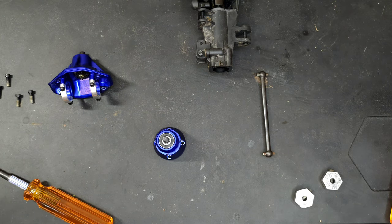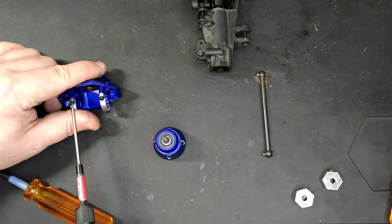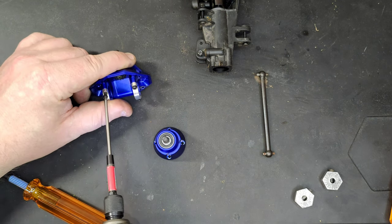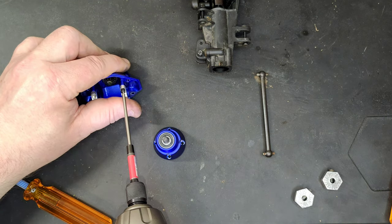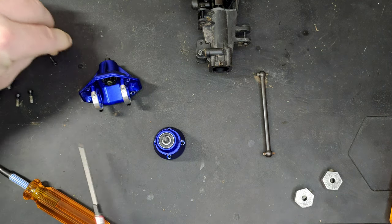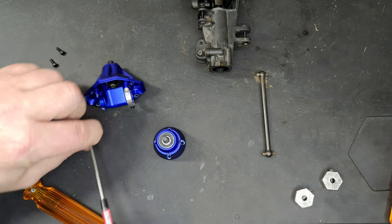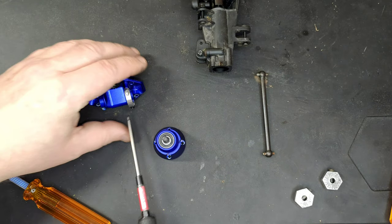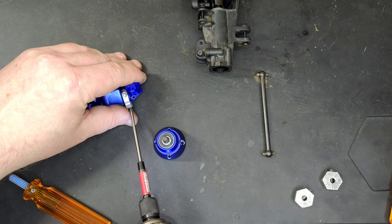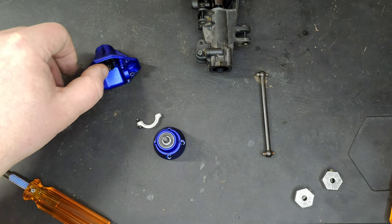Because on the Vitavon one, we're going to have to put the diff casing, the diff and the casing in the actual axle housing before we put the drive shafts back in. Because we're going to have to close the housing up, due to the fact that the diff carrier is now on the cover and it's going to be bracketed in. So if you look on these, the inner side has the ridge cut out. So that's got that ready.